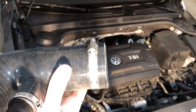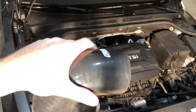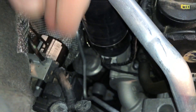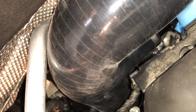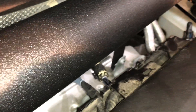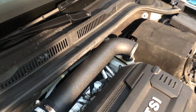I've prepped it. I have my hose clamp facing backwards with the hope that I can get a wrench back behind here in the space I have left in the bay. I've seated it all the way down and I'm going to move the clamp down over the bottom where it's going to overlap. Next, I'm going to connect those two pieces down there — hopefully just push it on and it's good to go. That was easy — it clicks right on one way. The post that comes down here that the bolt feeds through should be on the backside, closer to the passenger compartment.